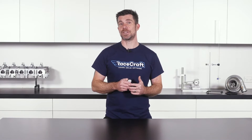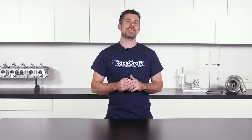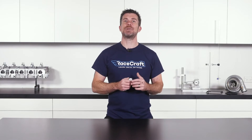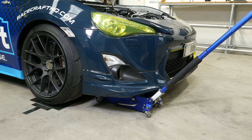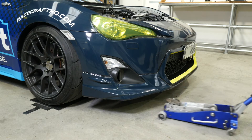One option to correct this is to simply roll the car back and forth a few metres, which will let the tyres settle into their natural position. However, after going through the trouble of setting up our string alignment equipment, that's not always a two minute job. A better and faster option is to use slip plates under the wheels while performing our alignment. These come in a variety of styles, however in simple terms they consist of two metal plates with a PTFE coating which can easily slide or move relative to each other. We place these under the tyres and then when we lower the car, the slip plates slide on each other, allowing the tyres to move into their natural location with minimal friction.